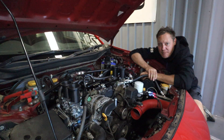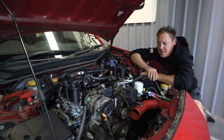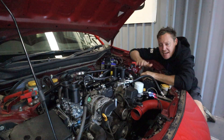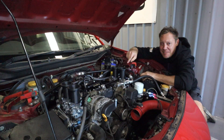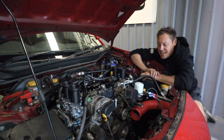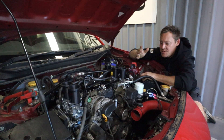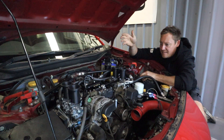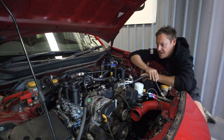So we finished up tuning the Link Plug and Play ECU. We didn't really make much gains in the peak area — Toyota and Subaru obviously tuned it quite well as it is. We definitely made a lot more torque everywhere, even more so with the trumpets that we 3D printed for the setup just for a bit of fun. Sorry Saad. With the Link ECU, it gives you the ability to tune this sort of setup and customise the engine without the standard constraints and limitations that you might have with a flash tune on the stock ECU.